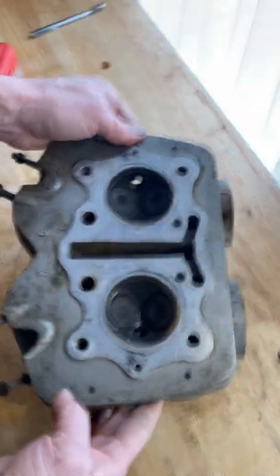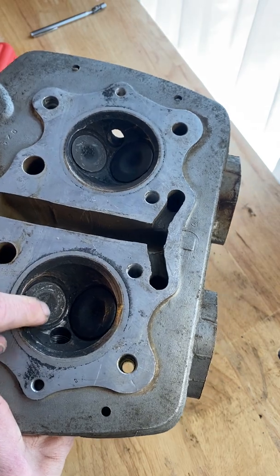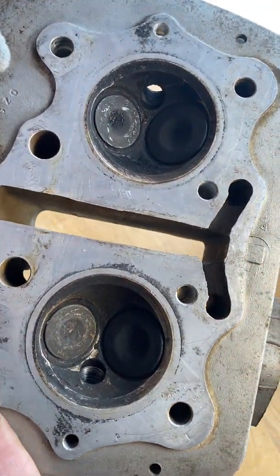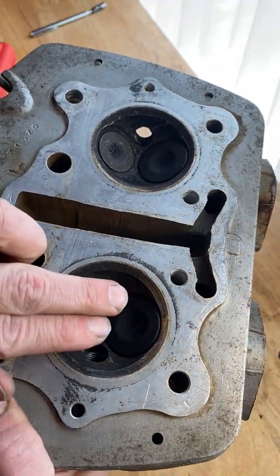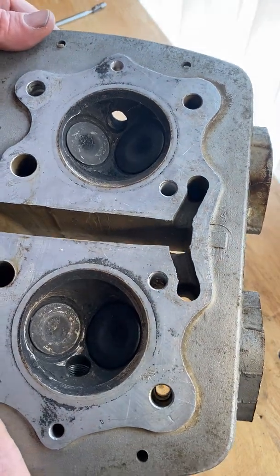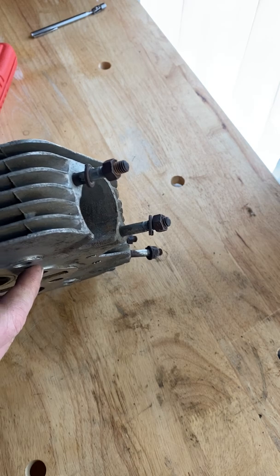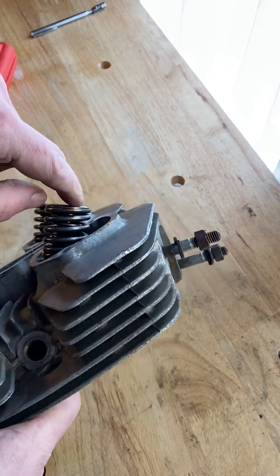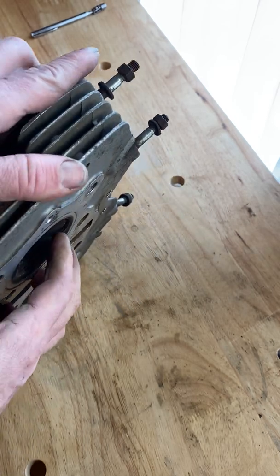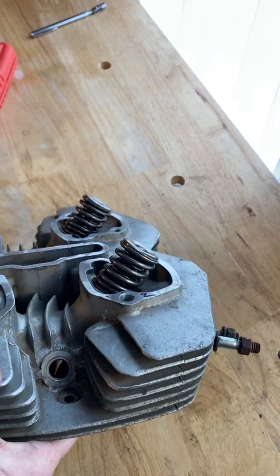And underneath these 4 circles here, 1, 2, 3, and 4, these are the faces of the valves. And these valves move up and down. They click open and closed. The valve, there's a long stem that goes through the spring, through the cylinder head, and connects to this face. We are going to be removing all of that.